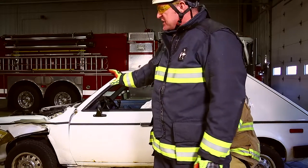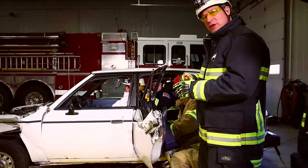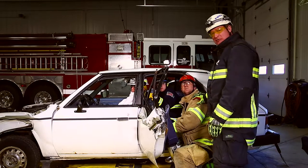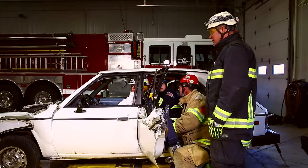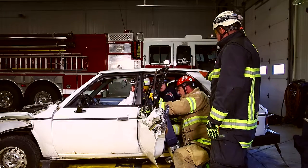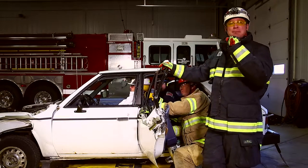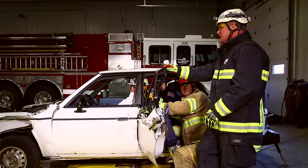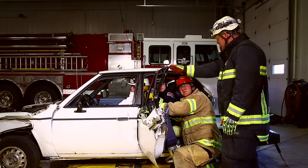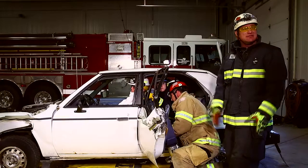Bobby's got that compressed now. He's going to skin out that body panel fender to expose the structural elements. Before any vertical posts or roof rails get cut, as a rescuer on the inside you want to make sure these guys are removing all the cosmetic panels inside of those posts. If SRS components are hidden or embedded in any of those posts and we cut them without identifying them, we can have catastrophic failures. Those failures include 1,500-degree Fahrenheit chemical burns, rapid expansions of steel pellets deploying from seat belt tensioners, or accidental airbag deployments. If you see them getting ready to snip a component and they haven't skinned out the plastics, ask them to stop and identify where those components are.